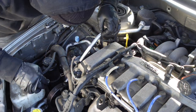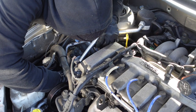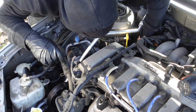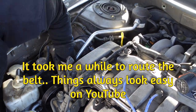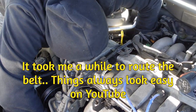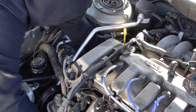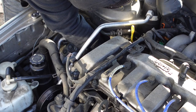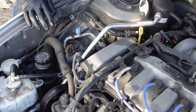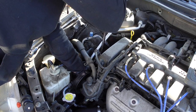Slide the new belt and route it around the pulleys. I made a belt diagram so you guys can pause the video and check out how the belts are routed — the alternator is referred to as a generator on the diagram. Once you route the belts around the pulleys and get to the last pulley, use a pry bar to push it onto the pulley.